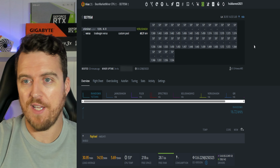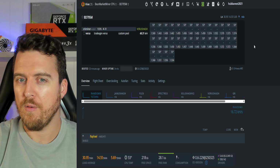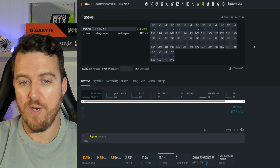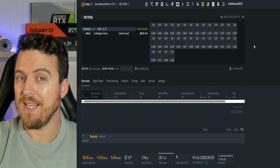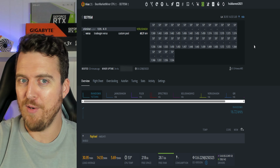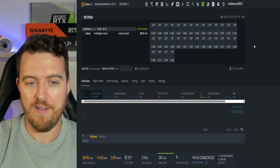Now, it does say that these can run upwards of 90 degrees Celsius, but one of the huge advantages of undervolting and dropping those power temps is less thermal wear on your hardware. I'm much happier making a little bit less revenue and having this CPU running 30 degrees Celsius cooler than it would if it was making that little bit more and not even earning as much profit.